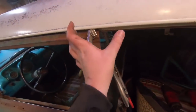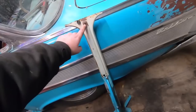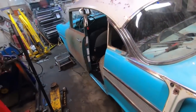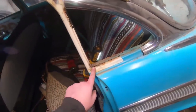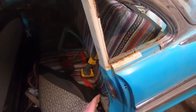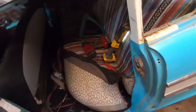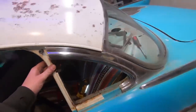Now the next thing is to fit that post in. I'm going to do a little research — I don't know what I'm going to do with this piece right here, but that's the thing with metal: you can just grind and weld until you're happy. I took the back window out and a little piece of the chrome, because you're going to have to cut this piece out at a bit of an angle. For the inner structure, a lot of guys just skin it and weld it in, but I want to keep as much of the inside structure as I can for strength.